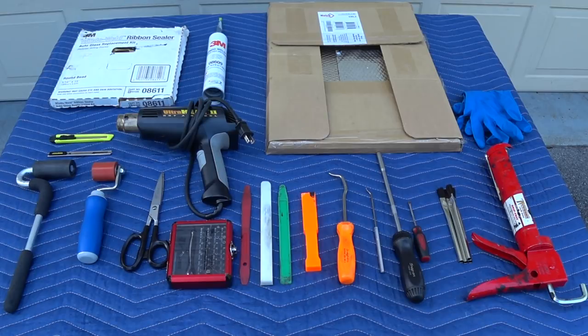You really have to take into consideration what causes these issues. It's usually similar or dissimilar materials in contact when the car is driving, vibrating, or experiencing any kind of shock — which causes tolerances of all those materials to shift and move. Whether it's a door panel, interior trim panel, or the unibody of the car twisting, the process here is to dampen and isolate those problems and make the fit tighter — eliminate the tolerances between door panel clips, between panel clips, between plastic materials that are bonded or plastic-riveted together.